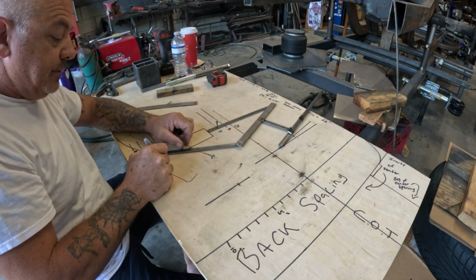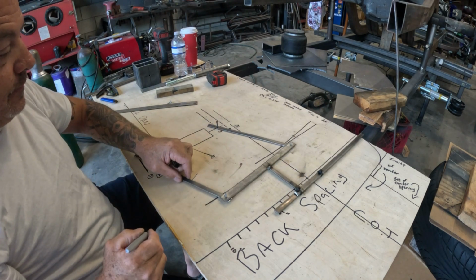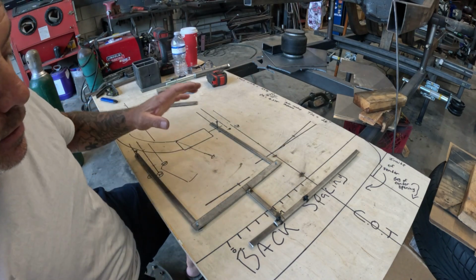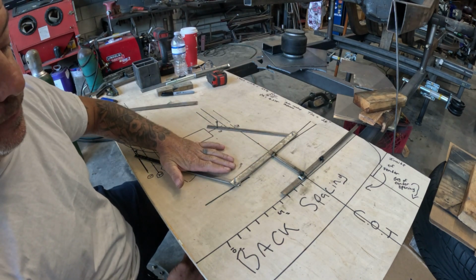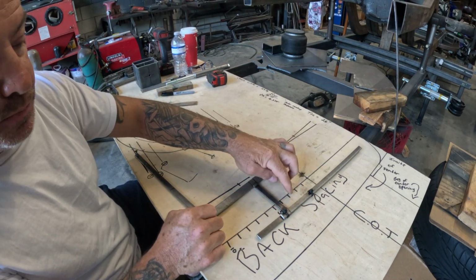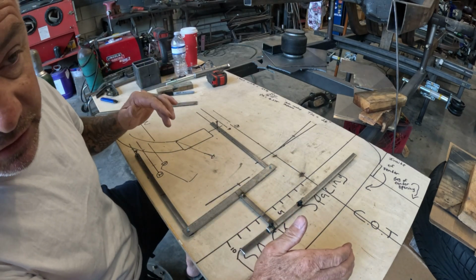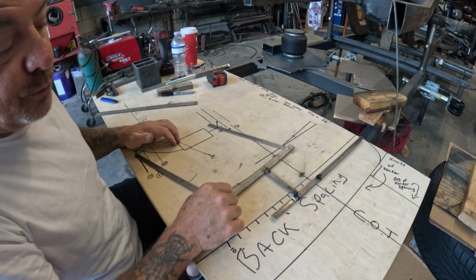And same down here. 3, 2, 1. Okay? So now if you cycle the suspension, you see the suspension travels really nice, but we're running into an issue. What's happening is when this is bottomed out, when you raise the suspension, the arc from the suspension is pushing the wheel into the fender, which is no bueno. Customer, again, wants a very specific wheel with a very specific offset. So we have to figure out a better way. This is not going to work.